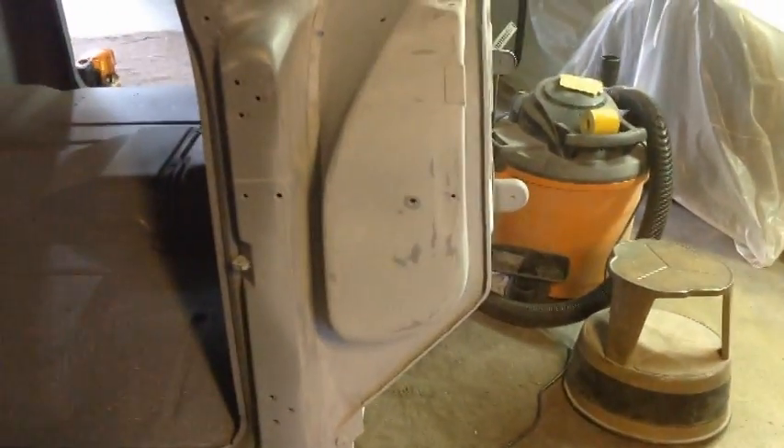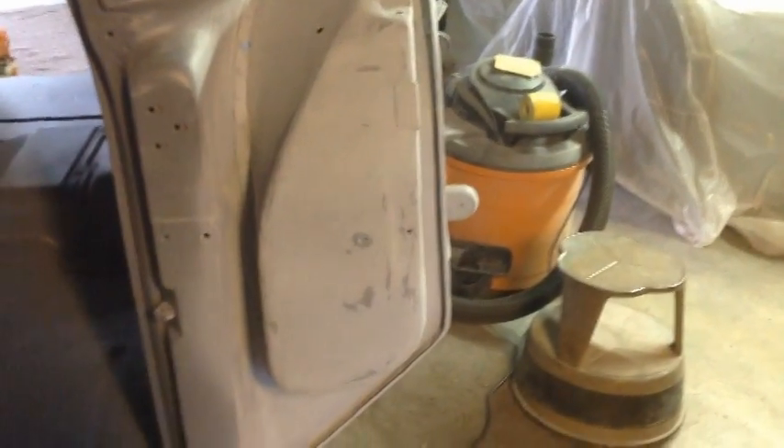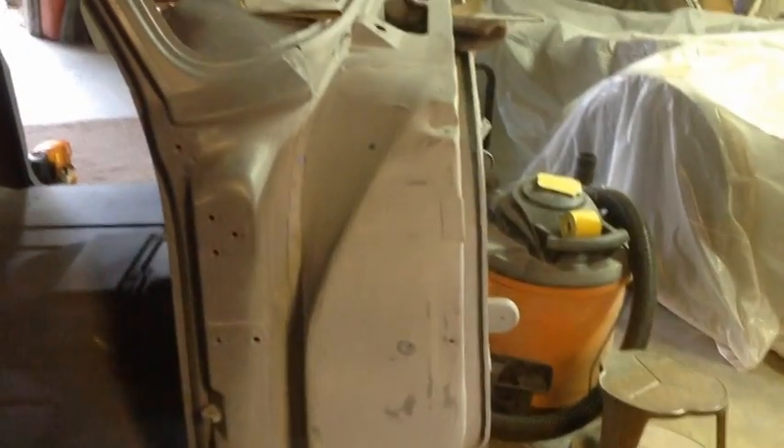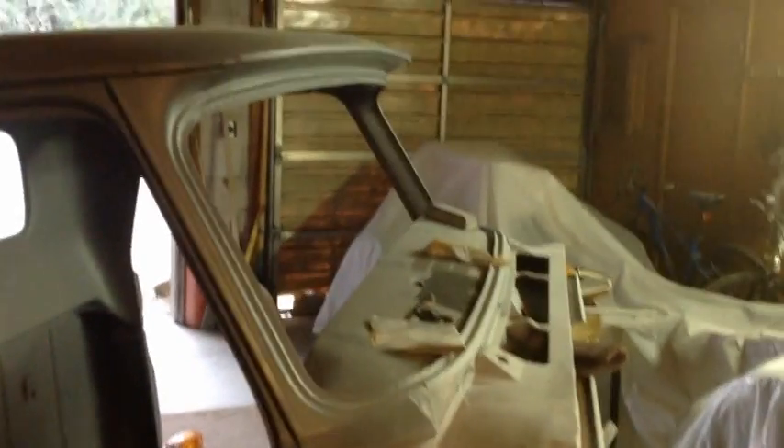The 600 seems to be doing the trick. This is the first time I've actually taken the time to sit and sand on primer and do some body work, and all I can say is, man, that's amazing. When you can rub your hand across metal and it feels like glass — that's the first time I've ever had that feeling. Hopefully all that will really make the paint come out nice. I'm going to do a three-step cleaning process to get this metal as clean as possible. On probably Friday I'll finish block sanding it, Saturday I'll start taping everything up, and maybe this coming Monday we'll start getting some color down and maybe some clear.